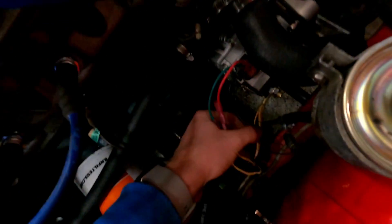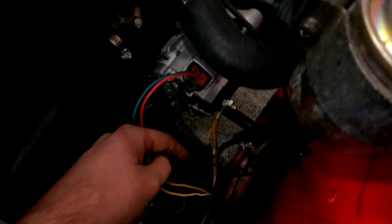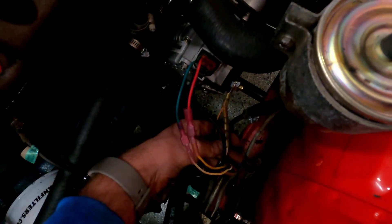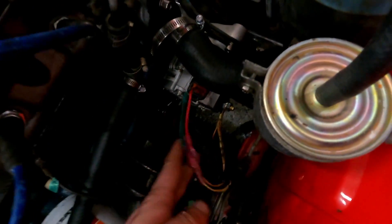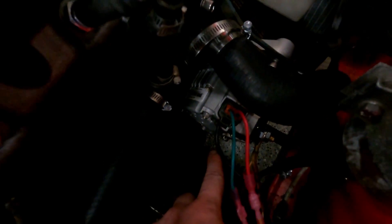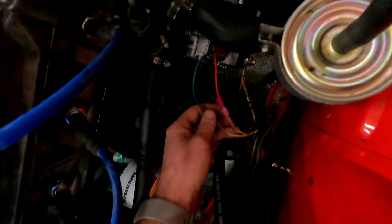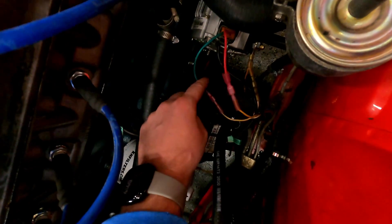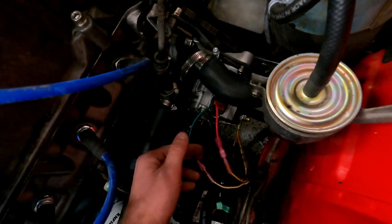The other modification is you're going to have to cut this wire so you can hook it up to the 12 volt post of the alternator. Once you do that, this should also be grounded — that will reduce interference from the alternator. We also have our ground cable on the alternator as well. So four cables total: ground is just grounded at the alternator, power goes to power, 12 volt sense is on the right, and ignition is on the left.